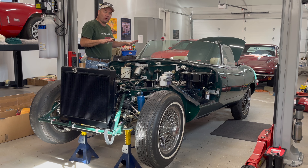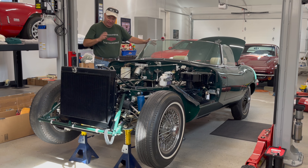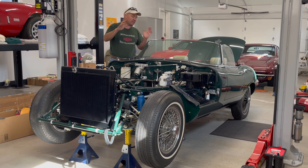All the metal work is done and the metal work is good. It's had some floor repairs and it looks like the left-hand outer and inner sill were replaced, and the work is good. It looks like the right-hand is still original. The floor is all solid. The paint work is very, very good — it's still got dust on it so I don't want to start digging away at that. The bonnet is done and in paint, but it's still apart and needs to be reassembled. That is in a storage room downstairs — we're going to take you down there and show you that.